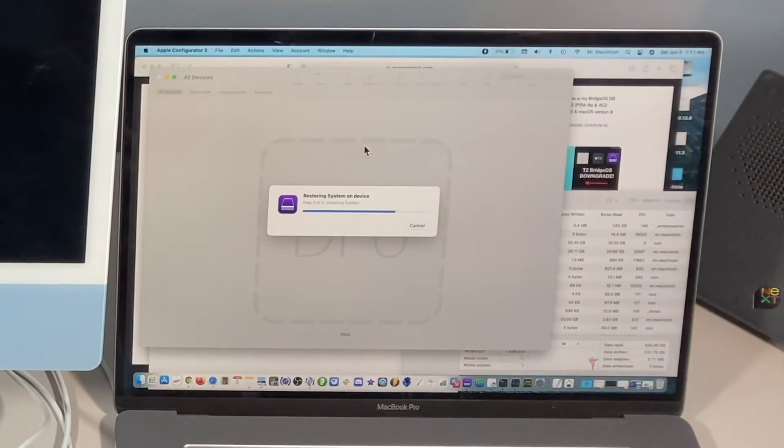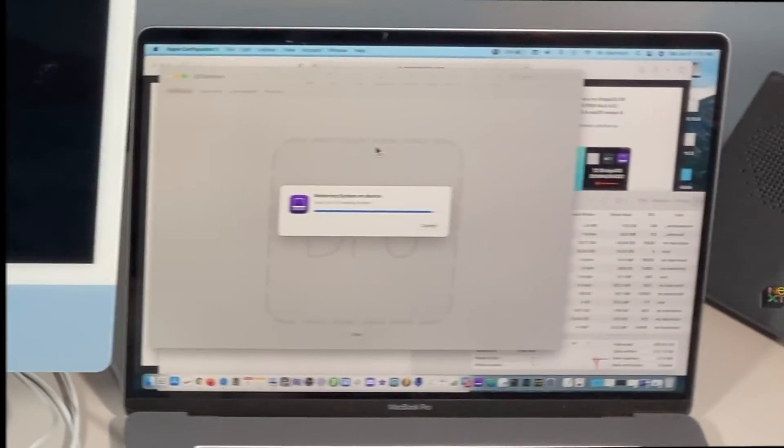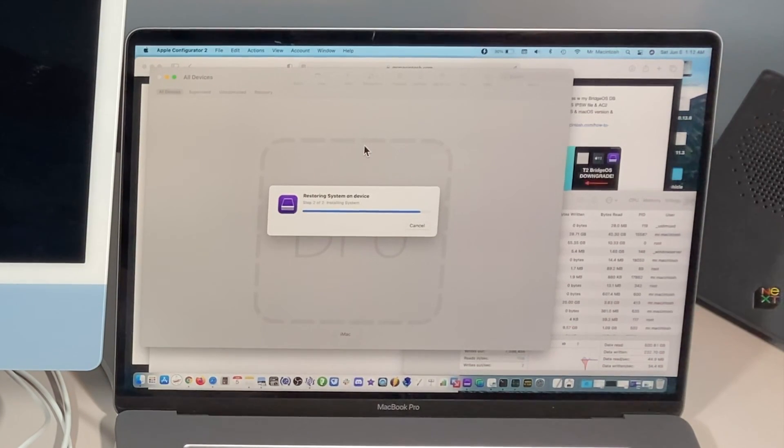That's why we covered this as the third way — not everybody has a second Mac to do this. That's why we first went over macOS recovery, which requires nothing extra. The second part was using a USB flash drive to install macOS Big Sur. And the third and fastest way is Apple Configurator 2 with an IPSW file. If you're doing OS testing or multiple M1 Macs at once, this is the way to do it. For home users, macOS recovery or a USB flash drive is probably best. I hope this video created value for you — if it did, click that thumbs up, subscribe for more, and I'll catch you in the next video.